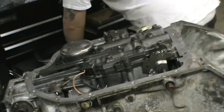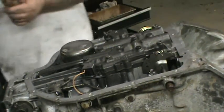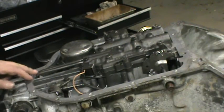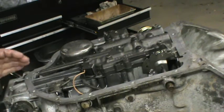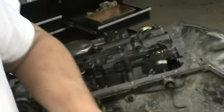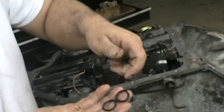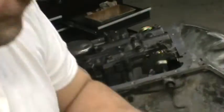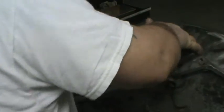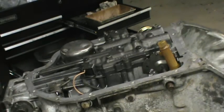Now we're putting a deep pan on this one, so we're going to do a deep pickup. Usually when you get your rebuild kit you're going to get a baggie like this. I already put the governor screen in — you're going to want to put it on this side, not this side. You want to put it to the inside because this is a supply and that's the return. There are a couple of different o-rings that come in that kit also. You want the largest o-ring in the kit for your pickup. This one says 'case filter' — pop it in there. If this thing looks like it's blistered or cracked, get another one; they're not that expensive.